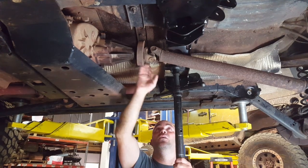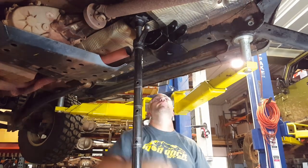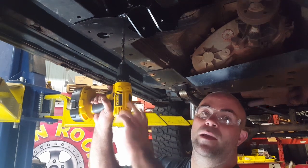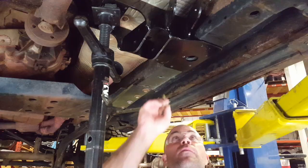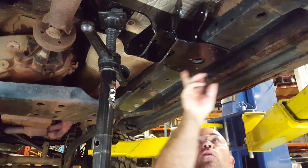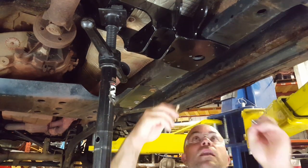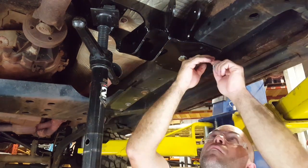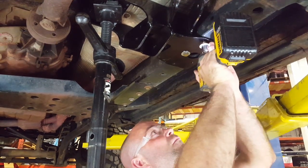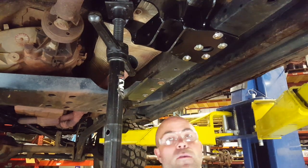If you really want to keep your harmonic balancer, you can relocate it a little bit to clear. We've got everything lined up with a jack stand holding the subframe in place. Now it's time to drill our five mounting holes on each side — make them just slightly oversized for ease of installation. We've drilled the holes, taken the subframe down, and touched up the paint. These two pairs of holes get nut plates, bolts, and washers; the individual hole gets a regular nut. The nut plates take a little patience — snug them up and then come back with a torque wrench to torque to spec.